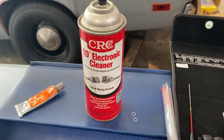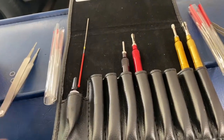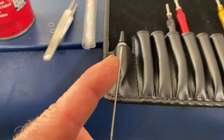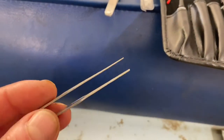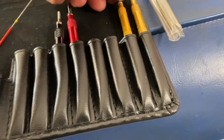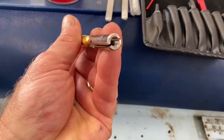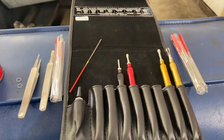First I'm going to get them with this a little bit, let it sit, and then after I'll use the dielectric grease tube I've got. I was a little disappointed to find out I don't have any flat files - this is probably the one I'd have to use in there. This kit comes with these little diamond-impregnated deals, so you can clip on and clean them up. There's a smaller round one for round plugs - one does the socket, one does the male - a couple different sizes.